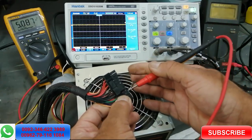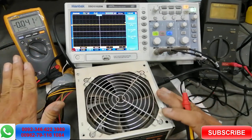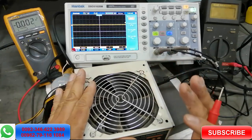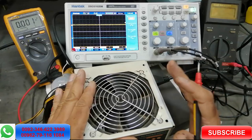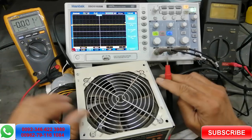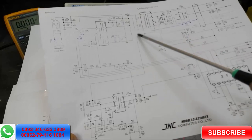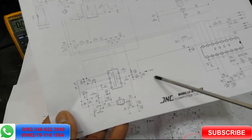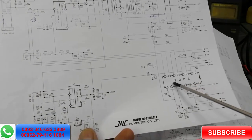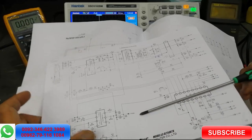Now check the green wire — it must also be 5 volts. When we have both of these voltages, our power supply is ready to take a command. The AC input is filtered and rectified, then it goes to the standby section which generates 5V standby power. This 5V applies biasing voltage to the SMPS controller and other circuits, and also sends voltage to the motherboard to enable reset.